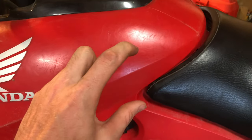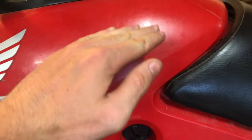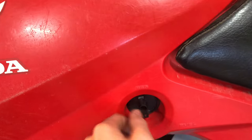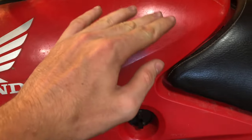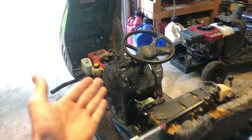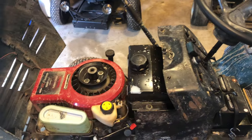Basically when it's on, there's a tube that sticks up a bit inside the fuel tank and the fuel runs down. It'll start cutting out and that lets you know you're low on fuel, so you switch to reserve and that opens up the very bottom so you still have a little more fuel left. It's the same principle but instead of one tank it's two separate tanks.